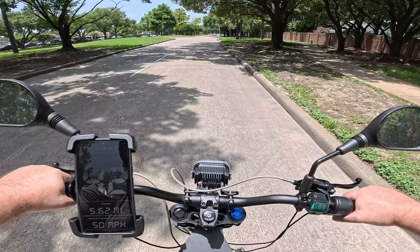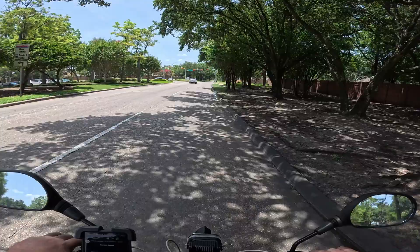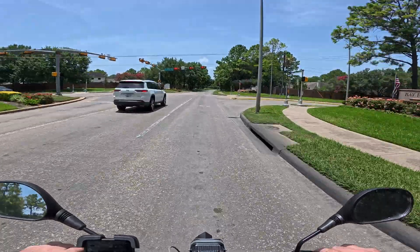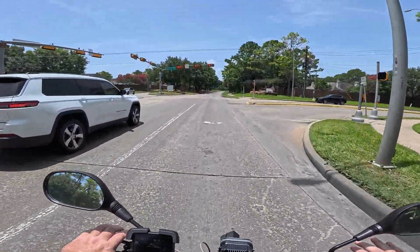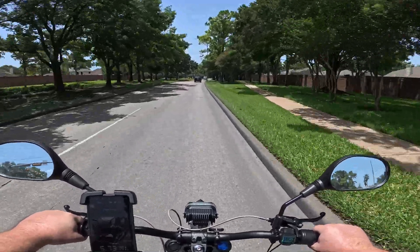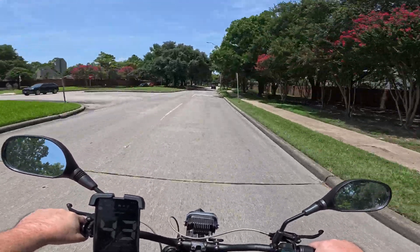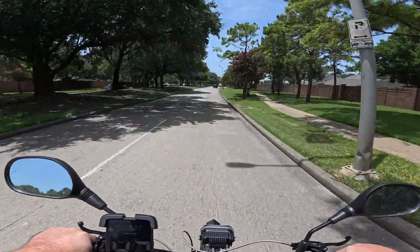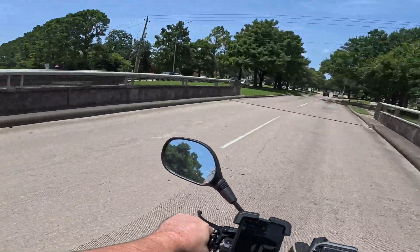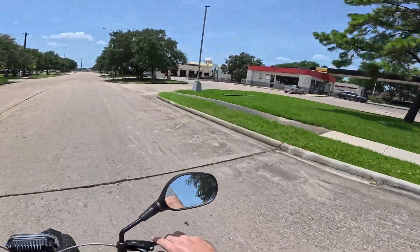It's just fast and fun. I was contemplating ordering another motor — instead of the 273, I was going to get the QS205 4T 5 kilowatt and keep everything tuned exactly the same, maybe lower the phase amps back to 480. But shipping wanted like $500, which includes the wheel, motor, tire, and everything — basically plug and play. I was like, I've already spent enough on this, and it actually is pretty fun since I went in and did all the tuning changes. It does feel a lot better.